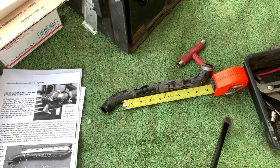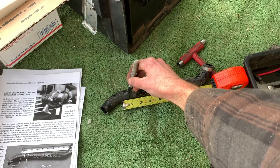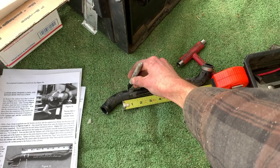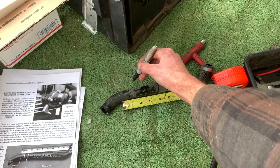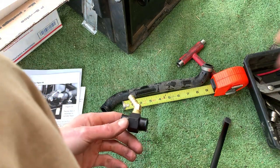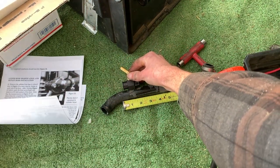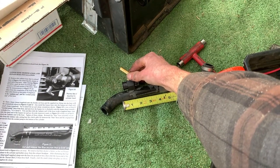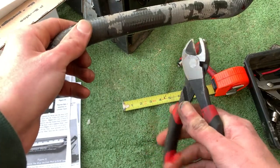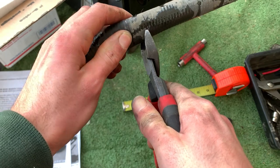I've got it roughly at the point of tangency. I'm going to do a three-quarter mark with my black marker on this black hose, then five-eighths from that point — that's what I'm cutting out for this piece to fit in here. That five-eighths section makes sense because if you look at it, it actually fits perfectly in there. There's probably a better tool than this but I'm going to be super careful. I'll get a little incision point right there.